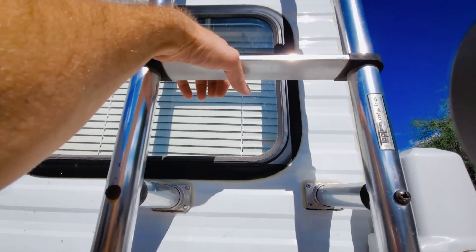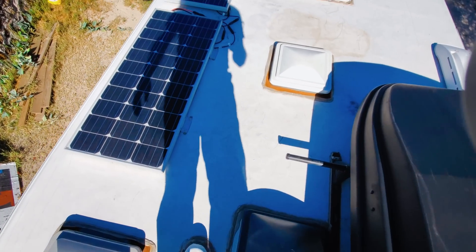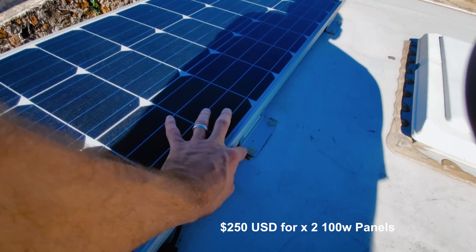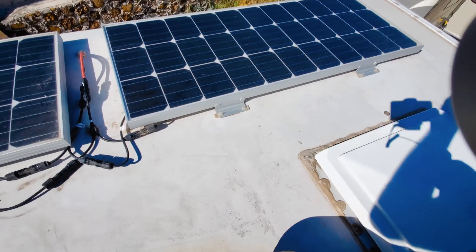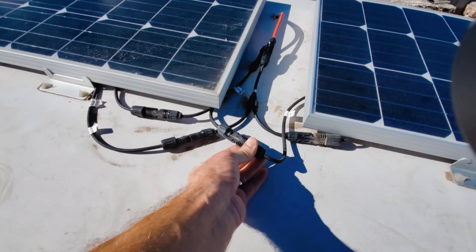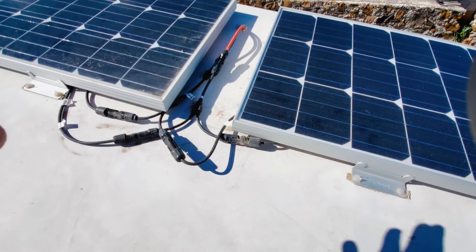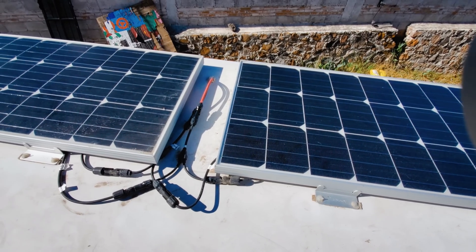Let's go up here — I'm just going to crawl up. You always walk gently on these RV roofs; they are not very tough. You're going to buy some solar panels like these little 100-watt panels right here, and then you're going to buy solar panel brackets. These are all pretty standard things — you can Amazon them. You're going to get panels, brackets. Usually they come with connectors like an MC4 connector. There are some different variants of the MC connector. They come with leads, positive and negative leads coming off each panel. This is a 12-volt; some panels are 18 volts, some panels are 24 volts.